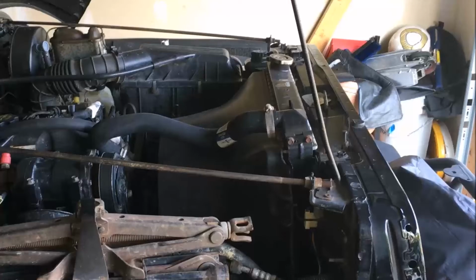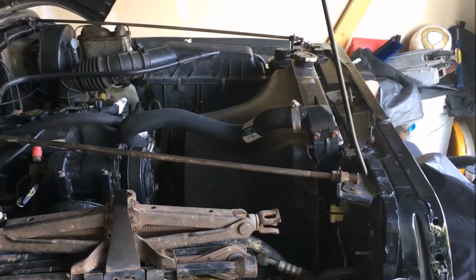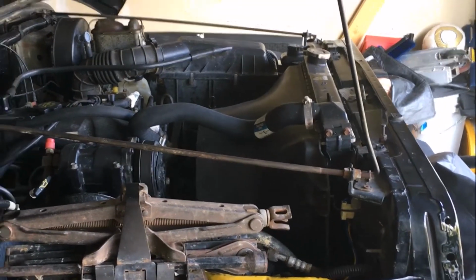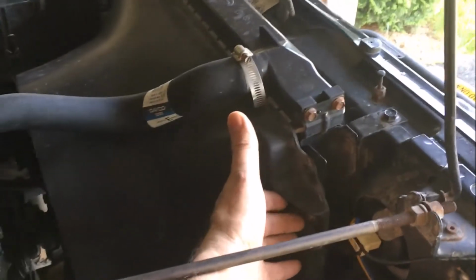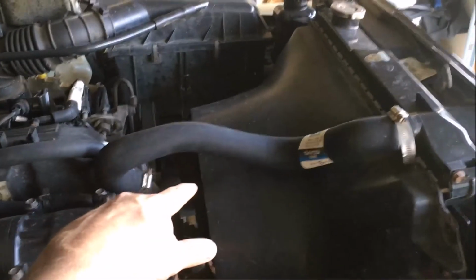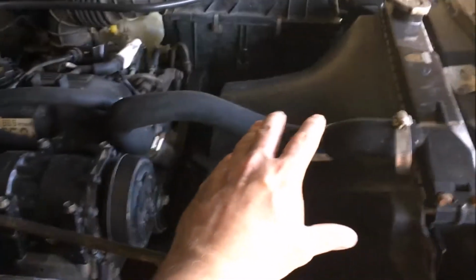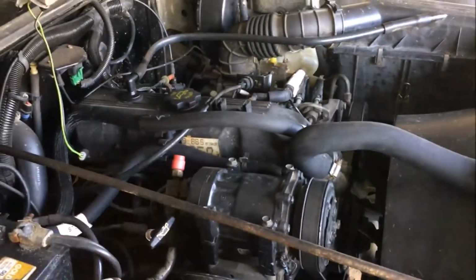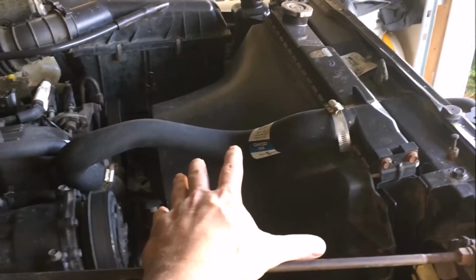The motor mount is the very first step that you take when you're doing all the steps to get the belly pan lifted up and get that tummy tuck done. One of the first things you're going to do, before you start taking the motor mounts out, is come in here and remove the bolts for your fan, because as you move the motor up, the fan is obviously going to move up. It's going to bang into the shroud and everything. So it's easier to unbolt this first. You don't have to remove it, just unbolt it so there's room to move. Then you can jack up the engine, remove the mounts, put the new mounts in, get that all squared away, take the jack away, and then you'll know where your fan is going to end up, and you can adjust your shroud.